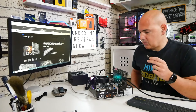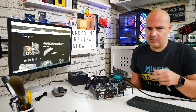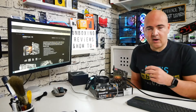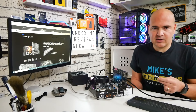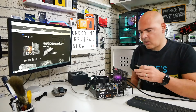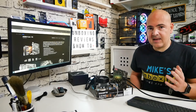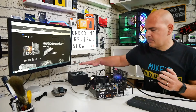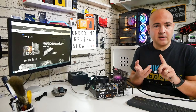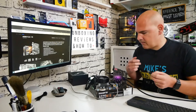It's a relatively small flash file. You'll also need a computer that can access the internet to get hold of this — I'll put some links in the video description so you can go straight to the website and get the appropriate BIOS for this particular board. I'll also put links for Gigabyte anyway, just so if you've got a different board, you can still get access. You will need your USB stick, a working PC or laptop to connect to. Other than that, all you'll need is a power supply and the bare motherboard itself. You don't need a processor, RAM, or a graphics card.